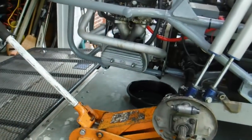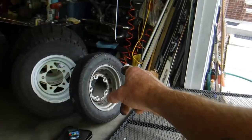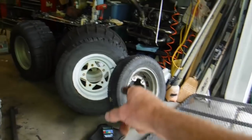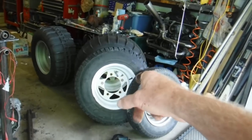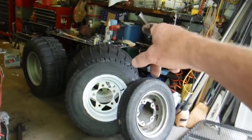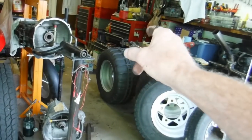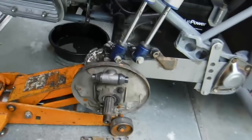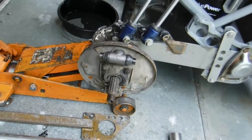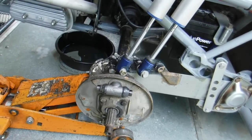I got it running yesterday, took it around the block, and it took way more pedal pressure than I would normally like. You will find that this is true when you run larger oversized tires. That stock wheel and tire weighs about 30 pounds — I just weighed it on the refrigeration scale. That big American tire, the big all-terrain truck tire on a steel wheel, weighs about 60 pounds. The desert track tire on a steel wheel is about 8 pounds less, and an aluminum wheel is even 4 pounds lighter. So when you've got these big wheels and tires, they're turning like big flywheels — you have a lot of mass that you're trying to get moving, so it's even harder to stop.